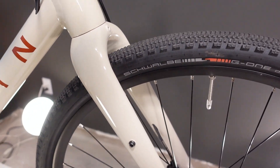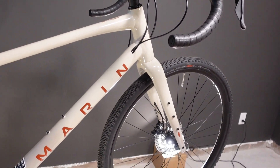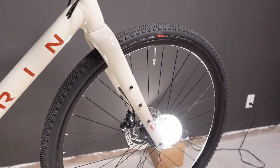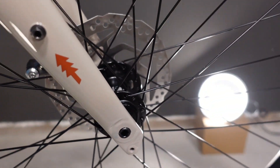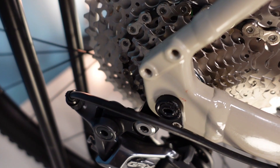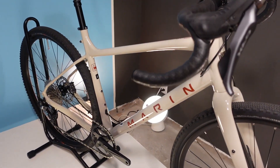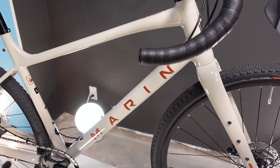The big reason for putting carbon on an aluminum bike is its ability to dampen fine vibrations. Vibration that goes into your tires — if you happen to be running them hard — instead of being transmitted straight up through the fork into your hands, will be a little bit dulled by having a carbon fiber fork. It is a through axle fork, so like the rear axle, the through axle gives us a stiffer, more torsionally strong connection, and your wheel's position in the dropout is absolute, so you have less chance of putting your wheel in slightly off and causing a rubbing brake.